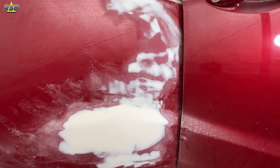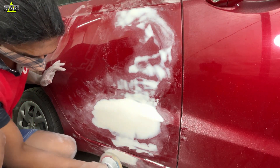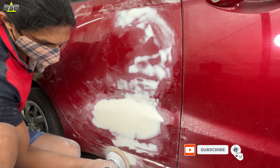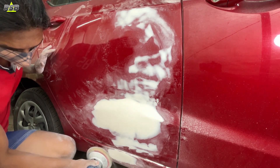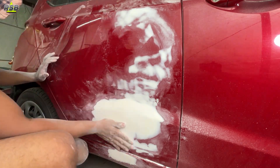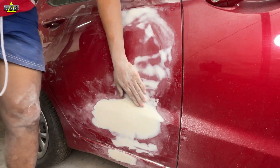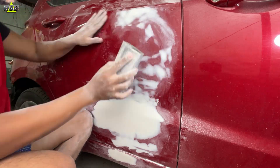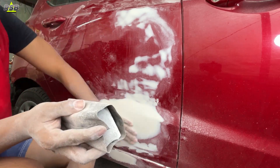Once I am done with the DA sanding my surface will look something like this. Now I will stop the DA sanding and switch to hand sanding. With the DA sander I have done the major sanding — removed the thick, uneven body filler and flattened the surface — but it is still slightly uneven. I will level that by hand sanding before I apply the sealer primer. Put a sandpaper on the sanding block and sand all the spots where you applied body filler. This is a light sanding — let the sandpaper do the work. It is only to remove sandpaper scratches and give a good shape to the body lines and curves.